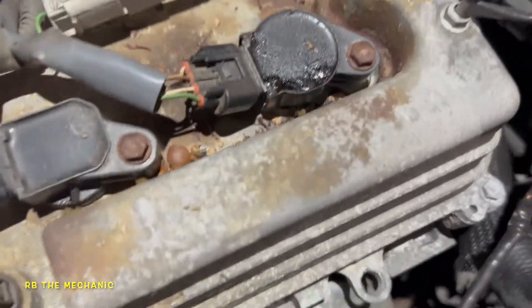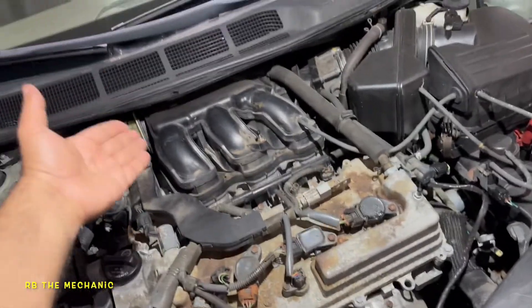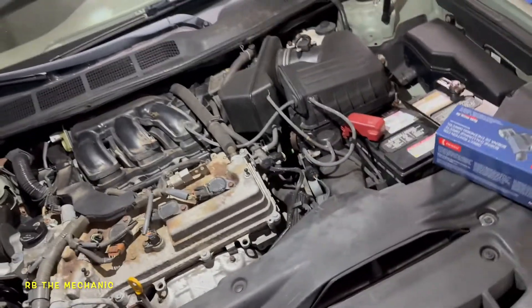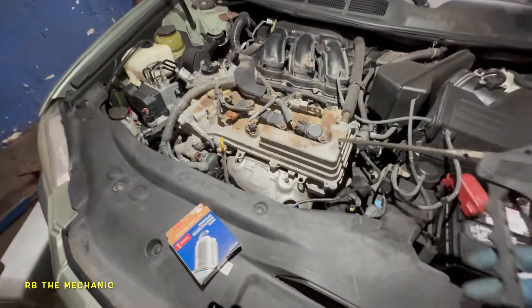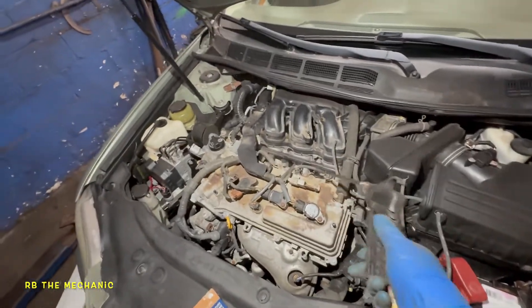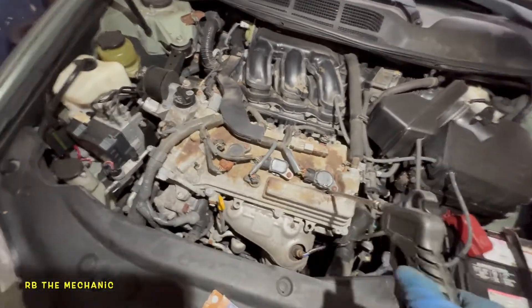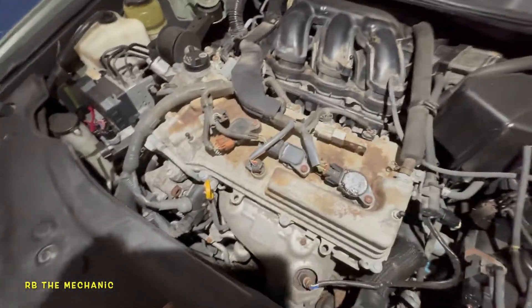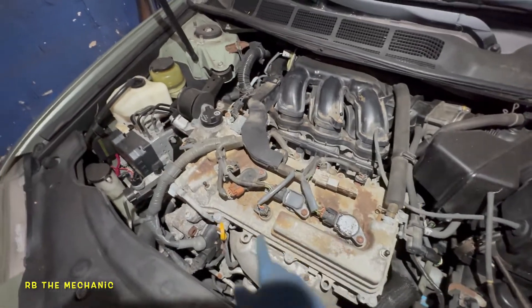It's burnt out, so it could be causing an intermittent misfire. We are going to change the plugs, but the customer doesn't want to do all of them now — he wants to do the front three today and come back next week for the back three. Also, always inspect your wires because sometimes a squirrel or rat will sit in here and eat the wires, which could also cause a misfire.